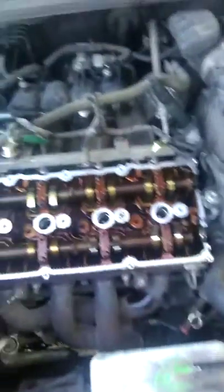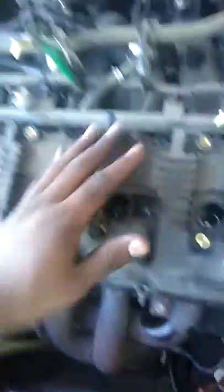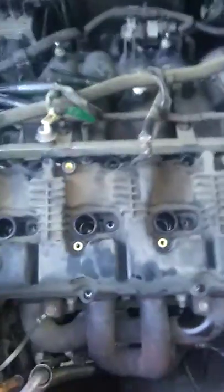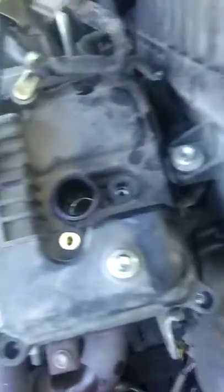This is also a good time to change the oil because new oil with sealant additives can help. So as you put the gasket on, make sure all these prong things are lined back up and dropped in right. Start putting everything back — I tend to forget to put stuff back on, so put this back on. These little clips here just push straight in like that, and then I can go ahead and put my spark plugs back in.